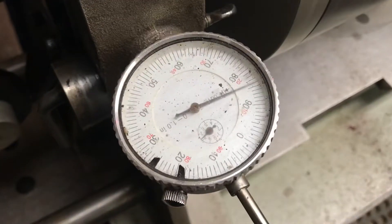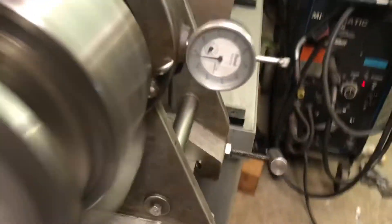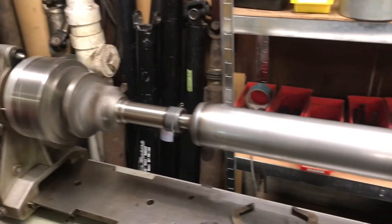That's cranking about 3200 right here. Zero at the transmission, zero at the rear axle — nice and flat. It's 58 and a half inches long center to center running length.